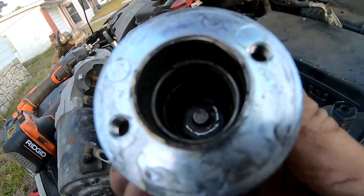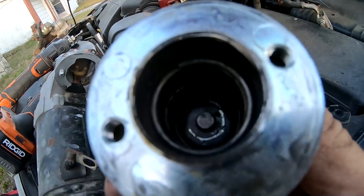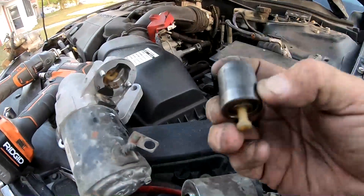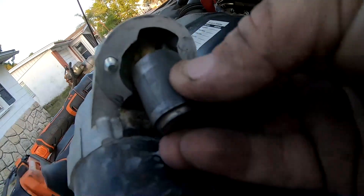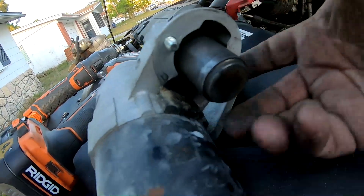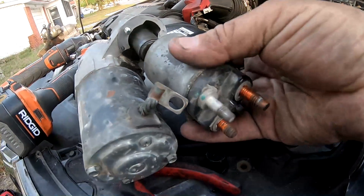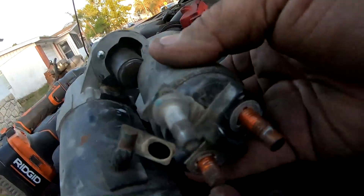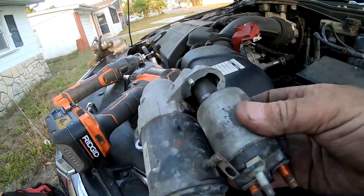The inside is a little hard to see but I cleaned it up with the Dremel really well. You might want to put a little bit of grease on here all the way around. Then you hook it in like that and put it back together — line up your two holes for the screws, make sure the shorter stem is on the bottom, then push it on and tighten the bolts down and you'll be good to go.